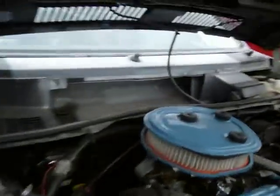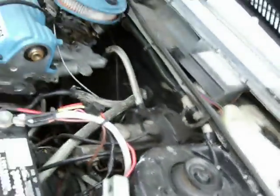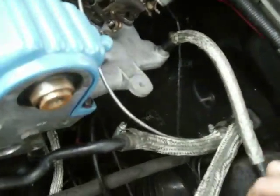All you need is, if you have a PCV valve with the factory valve cover, you've got the big box and a vacuum line that goes to the carb — that's fine. The only vacuum lines you need are the one from the intake manifold to the vacuum booster, and then the vacuum booster usually has its own split for the vents in the car, plus the vacuum line that goes up to the computer. I replaced my vacuum lines altogether — the stuff gets so old and brittle, I'd just go out and get some rubber hose. Vacuum line is cheap, and it gets rid of a lot of problems.